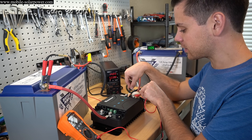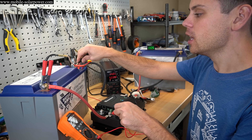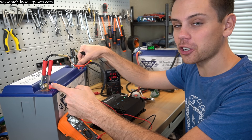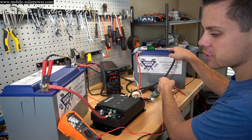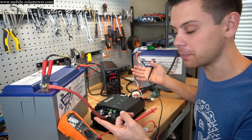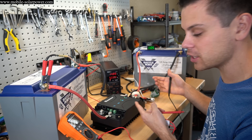We've got 12.6 volts on one battery — so it's depleted — and 12.8 on the other. I need to charge the starting battery up to 13.2 volts, and once it hits that threshold it will start charging the solar battery. I'm actually glad they're depleted because I can watch the voltage and test exactly when the threshold is triggered.